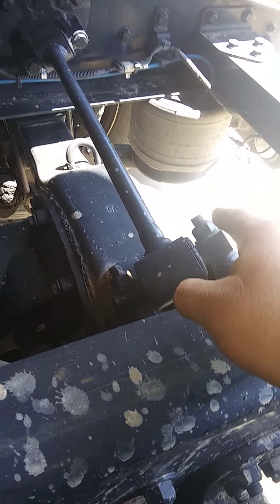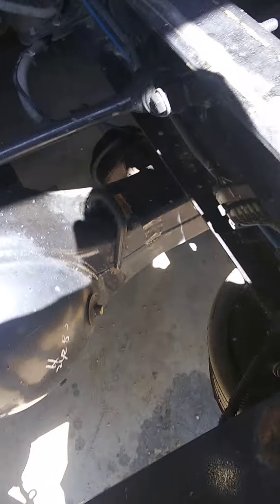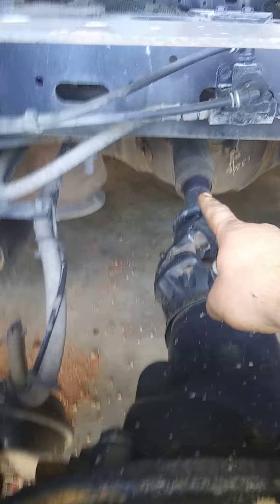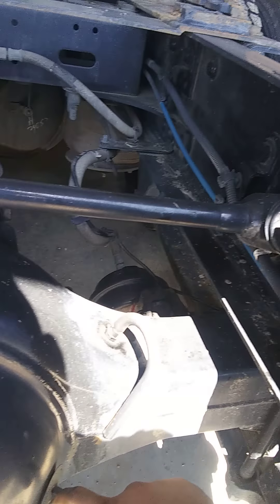Check your airbags. Check your pumpkins — you have to check your pumpkins and make sure your fluid is all the way to the top. You'll leave a little residue if you check it correctly, so it's easy to tell if it's been checked. You want the fluid to get at least to that first line of your finger — that's when you know you're full.